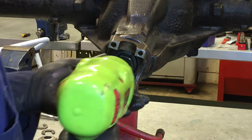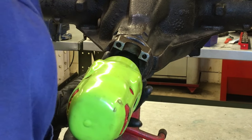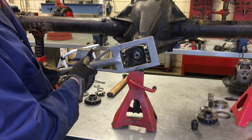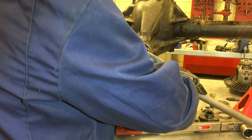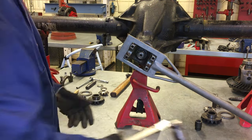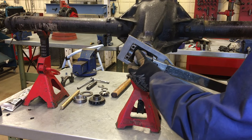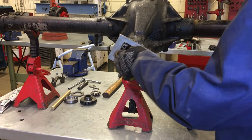You can still see that the yoke is plunging a little bit, which means we still have some extra play left between the bearing and the race. So we're going to put a holding tool on that pinion yoke. I'm going to let it rest against the table since we're doing this as a bench demonstration. In a car, you would place that tool against something solid so it couldn't rotate — many times I just use my stomach as I pull on the torque wrench.